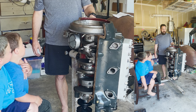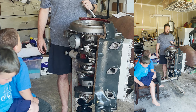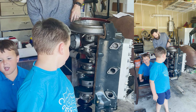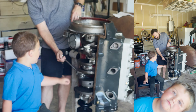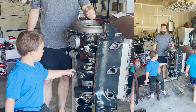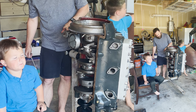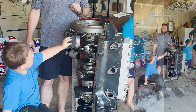Welcome back to Finnegan Begin Again. We have received our shoulder bolts for the clutch to be installed, so we're ready to do that. We have lock-wired everything — underneath here we've got our rod caps, nuts lock-wired, and also our journal nuts lock-wired. So we're ready to seal this up. There's one more thing we're going to talk about before we put that oil pan on, but in the meantime we're going to put the clutch on.